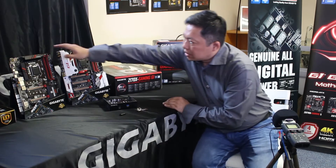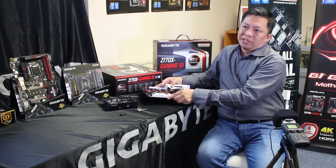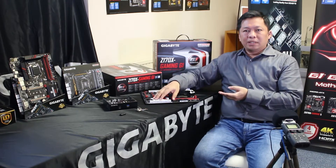On the gaming board we have three SATA Express ports, and even if you use the front panel which takes up one SATA Express port, that still leaves you with two. As a reviewer, that's the first SATA Express device I've seen — are there more SATA Express devices coming? SATA Express is not new since last year's Z97, but hard drive manufacturers said they were going to come out with SATA Express hard drives and unfortunately none of them really shipped. The main reason is that transferring from standard SATA interface to a PCIe base is totally different and still difficult for those manufacturers.